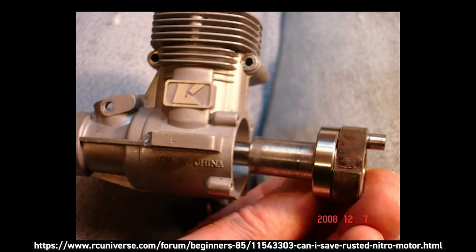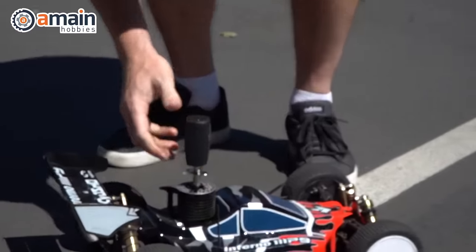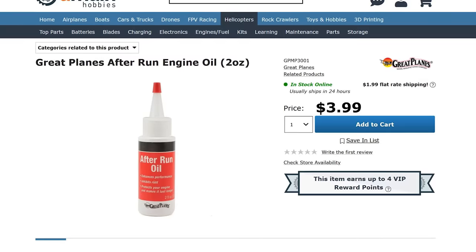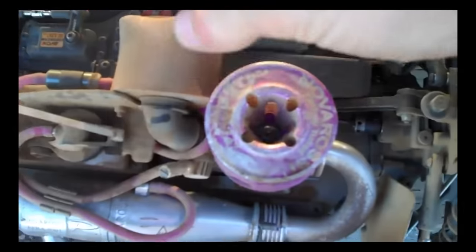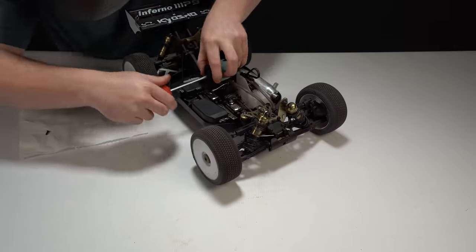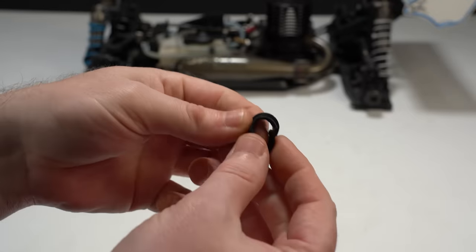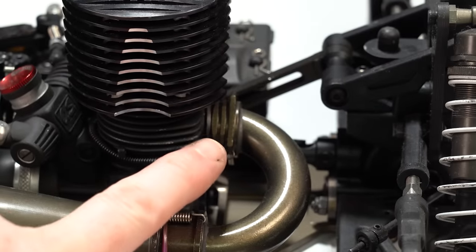For you nitro guys — if you're letting fuel sit in your gas tank and fuel lines, you're destroying your car. Nitro methane pulls moisture out of the air, and that moisture deposits into your engine, leading to corrosion and rust. After every use, dump out any remaining fuel and fire up the car a few times to burn any fuel out of the fuel lines. You can also add a few drops of after-run oil for ultimate protection against moisture. Two other ways nitro guys destroy their cars: using dirty air filters — a quick way to get dirt inside your carburetor and engine — and using ripped exhaust gaskets, which will ruin your engine's tune. Replace both regularly.